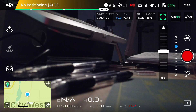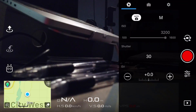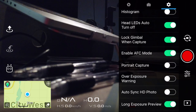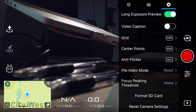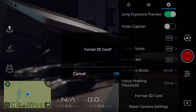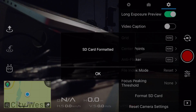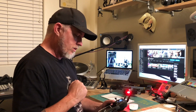Here's what you're going to want to do on this screen: press the settings menu, which is just below the record button. That pops up a menu where you can scroll down towards the bottom where it says 'Format SD.' Follow the prompts — it'll format your SD card while in the Mavic, give you confirmation that it's formatted, you click OK, and you're ready to fly and capture footage. It's really that simple.